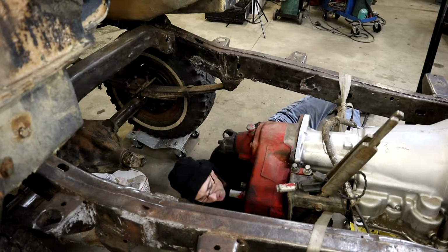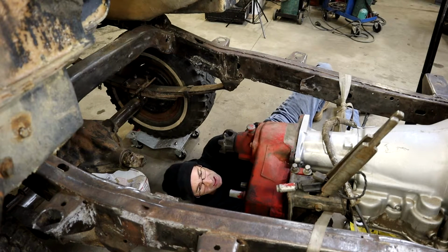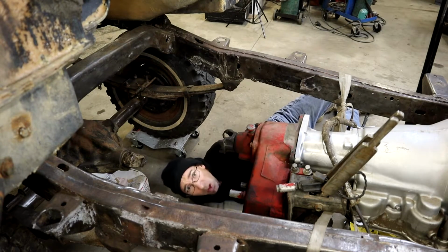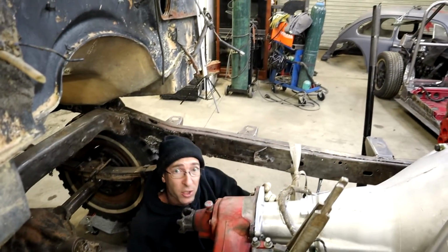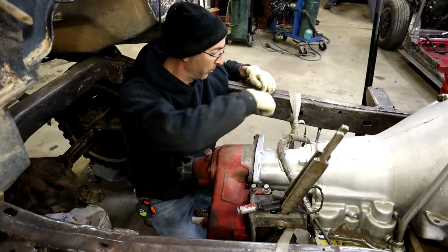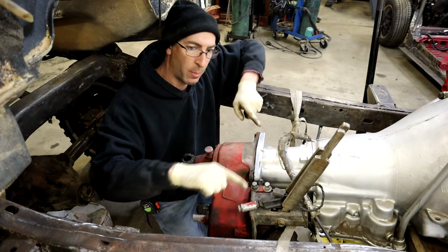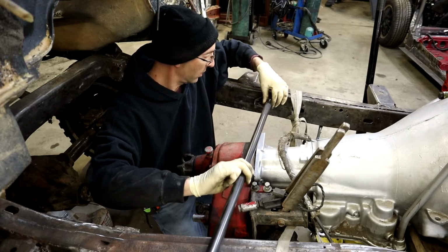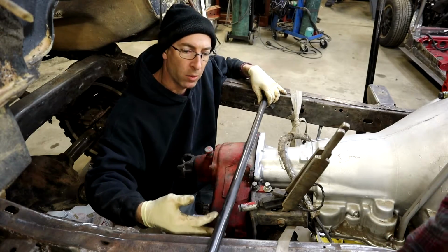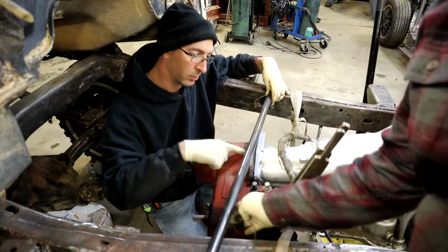Okay. So I'm gonna go ahead and get this off, because we have a plan. So that's the mount that I'm not using, and I don't believe we're using that either. I'm gonna keep it though. Reason being, we've decided to actually put our support right across the top. We have plenty of clearance now that I've dropped this down to bring a tube right about through here. We may have to put a little bit of an arc in it. Once I get it cut relatively close to where we want it, we'll measure that again before we put a bend in it. But there's enough room with this notch right here. Yeah. That we can fit that down in there.